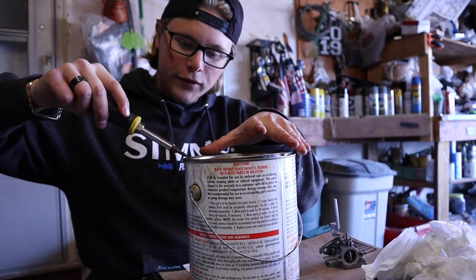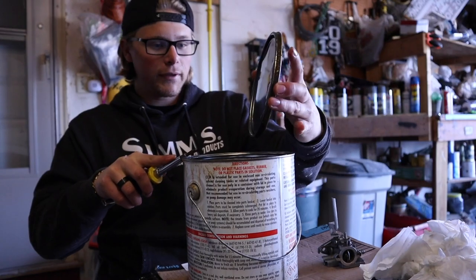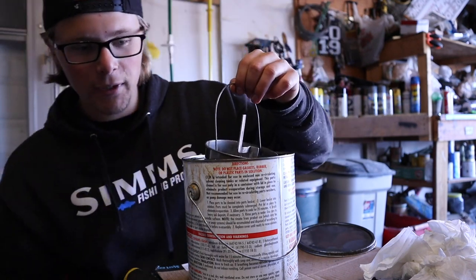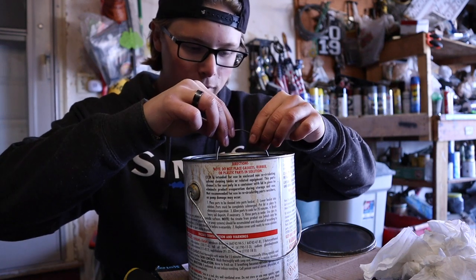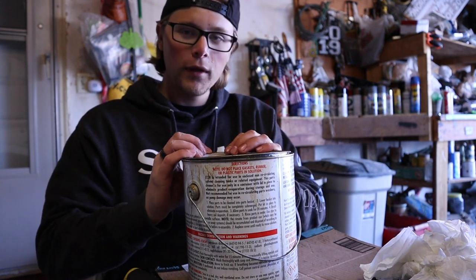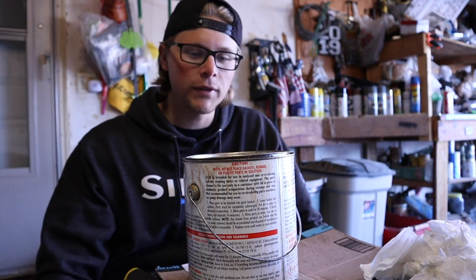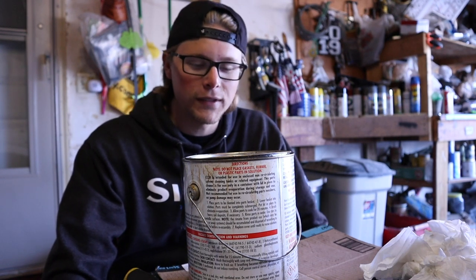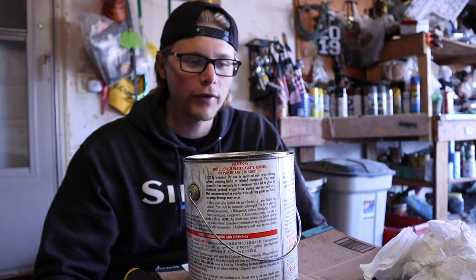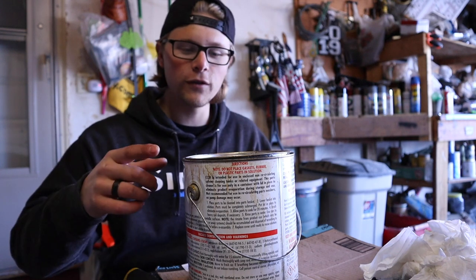Here's our tank of carb cleaner — this thing has cleaned a few already and she's still good. I'm going to put everything in this tray. Here's our entire carburetor — that baby's going in. I'm not going to put the bowl in it because the diaphragm is stuck to it and I don't want to rip it. Some gunk just came out already. Normally I would let it sit for a day, maybe two days, but for this one since it's not completely terrible and the real stuff I need to clean is inside, I'm going to leave this for one to two hours, get it out, blow everything out, then put her back on, do the test, adjust it, and we should be good to go.